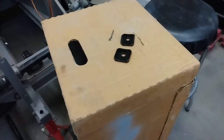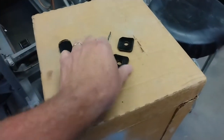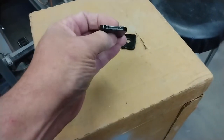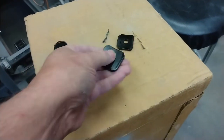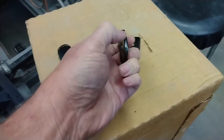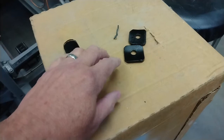While I'm on the subject of washers for the seatbelt bolts, the ones for the shoulder belt bracket didn't have any washers at all. So what I've done is I've taken some one and a half inch bar stock, about an eighth of an inch thick. I just cut some squares out and bent them a little bit to follow the curve of the wheel arch. So I'm much happier now with the attachment of the shoulder strap brackets.